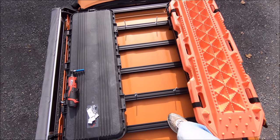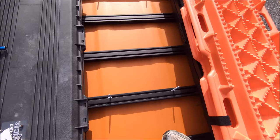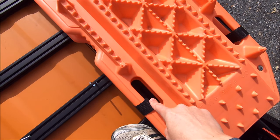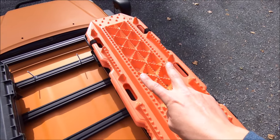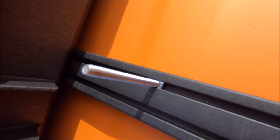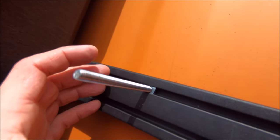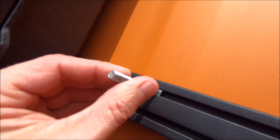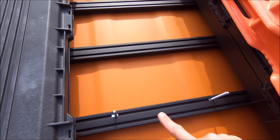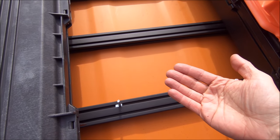I'm balanced up here on my rack — so if I fall and break my neck, this will be the last Tacomaholic video. As you can see, I've got these already spaced out. The threaded rods go through the grab handles, two in the back and two in the front, spaced out symmetrically so it's lined up the way I want it. These T-nuts just slip right into the channel — you don't have to slide them in from the side. I went ahead and tightened the threaded rod down into that. Now all I need to do is drop the recovery boards onto the four threaded rods, get the washer and the nylock nut tightened down, and that's pretty much it.